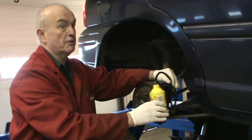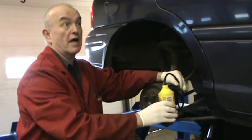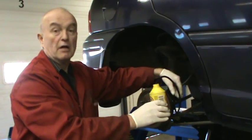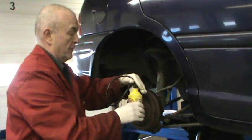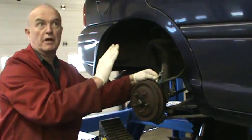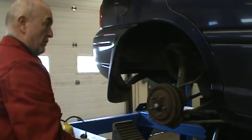Are you watching the master cylinder? Yes. Let the pedal remain in the up position and I'm going to close this bleeder. I put the hose in the container so it doesn't drip, and close the bleeder now. Any time a student closes the bleeder, it will eventually have to be checked by the instructor. Then I'm going to go to the other wheel cylinder on the other side — both were changed and we have to bleed both of them.